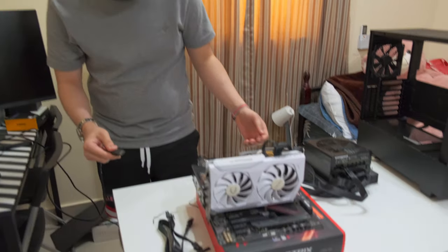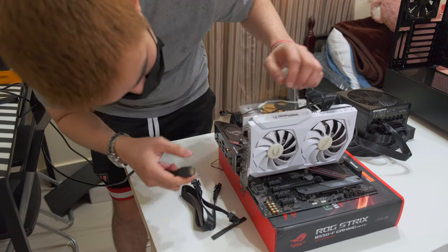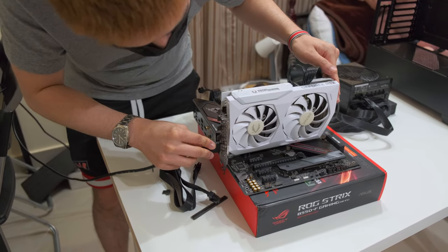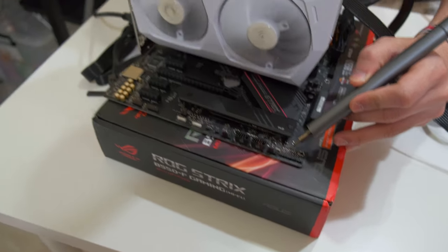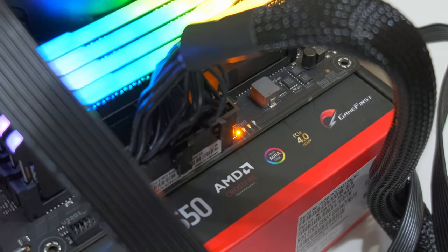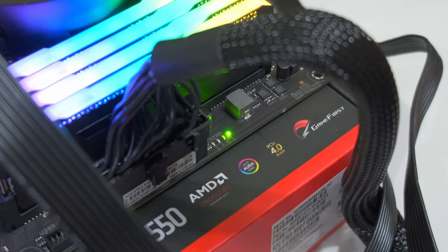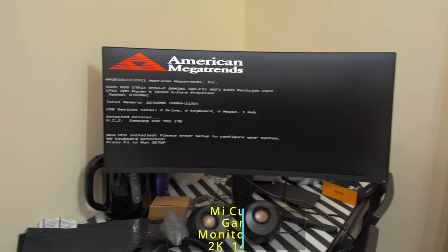Let's take the HDMI cable from the monitor to the GPU — make sure it goes to the GPU, not the motherboard. Push it in and let's try booting it for the first time. We can see the motherboard is turned on. There's an orange light, then red, then white — it's cycling through checks. And green — there's a signal. We have the Mi 34-inch ultrawide gaming monitor, which is 1440p. And voila — it booted!